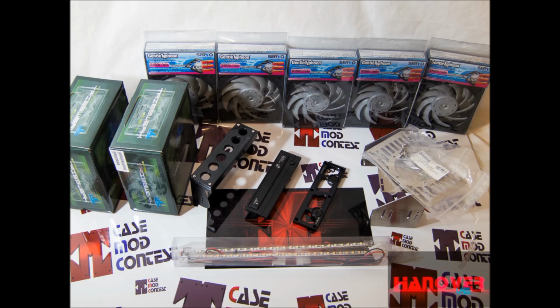Also, DazMode has shipped me some parts, some fans, some brackets, some face plates. We're going to actually cover some aerosol can spraying too. I'm out of etch primer for HVLP, so I'm going to be using a Dupli-Color etch primer out of the can. So we'll cover some aerosol shooting, and then also some plastic primer out of an aerosol can. We'll go into a little bit of how to treat plastic when you're going to cover with color, some of those preparation steps for the plastic.